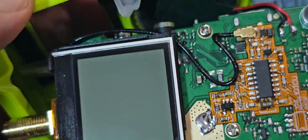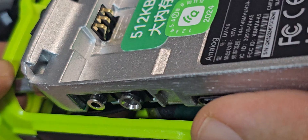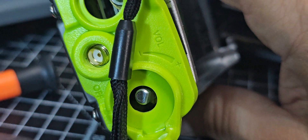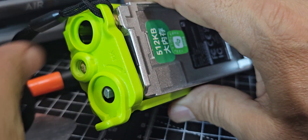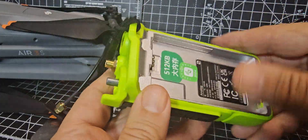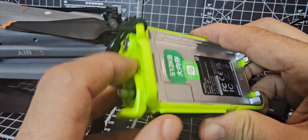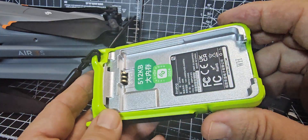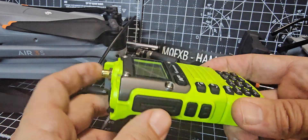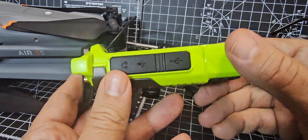I haven't yanked off the speaker wires yet — the red is on the right. You just turn it around, line everything up with the antenna holes like so, and then gently push it back through. That actually isn't connected to the board — the coax cable is the connection. This bolt just bolts onto the plastic, so remember that it's the plastic holding any antenna connected. When you slide it back in, make sure the coax isn't touching either side or in the way of the screen.